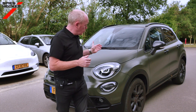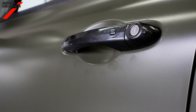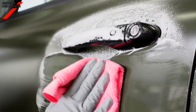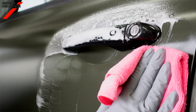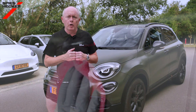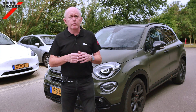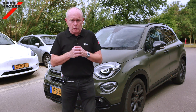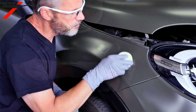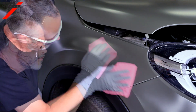My last point is about care during reassembly of the car. It's not uncommon that some slight marking or marring of the fresh clear may occur. In such cases these marks can be removed by gently cleaning the surface with a specific glass cleaner — simply spray onto the affected area, allow to stand for a few seconds, and then wipe off with a clean microfibre cloth. The matte cleaner or polish used earlier is a typical treatment for refreshing adjacent panels to help balance gloss level to your repaired area. Some products are more a type of wax and others more a cleaning spray, but what's important is that these are specialist products designed to protect rather than add gloss.